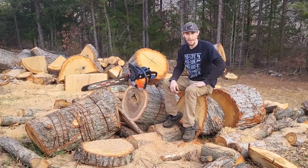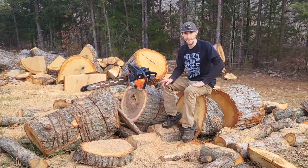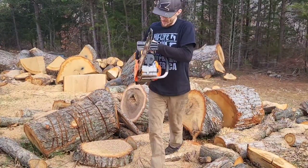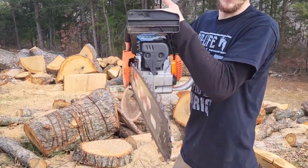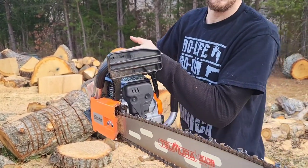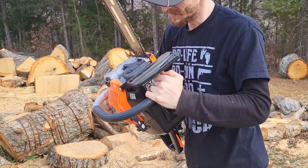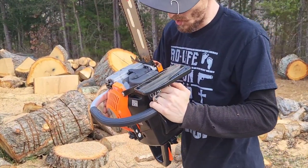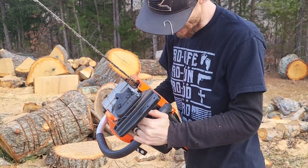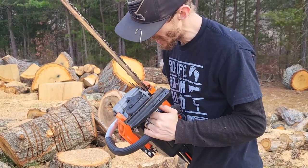I expect the exhaust is a major factor in what's holding this back, because looking into those three little vent covers in the front, she is pretty choked up in there. I only see maybe a 1/3 inch hole possibly inside of there, so that's definitely something later on to address.